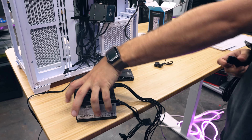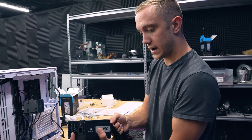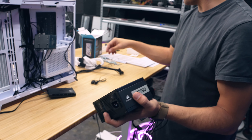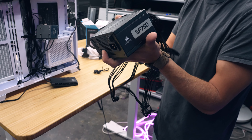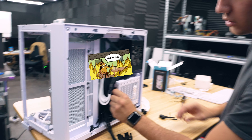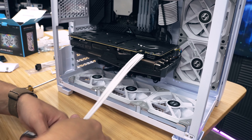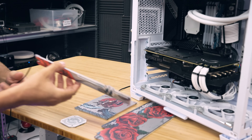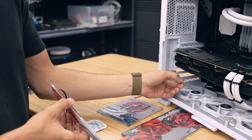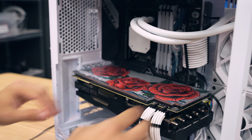Right now I'm hooking up all of my essential cables. There's not really much to do — I like to be pretty minimal as far as this goes. The only thing I have to do is hook up one additional SATA cable other than what I already have to plug in with the graphics card and processor cable. This is pretty much what most O11 builds are going to look like. I went ahead and sized up the support bracket — there was an issue with the screws being a little thicker than the threads in the side of the build, and they're at an angle so it's hard to reach a screwdriver back there, but got that all sorted. I already sized up the double-sided 3M circles with the magnets, so the back plate fits perfectly on the GPU. All that's left is to drop the mod parts in the build.